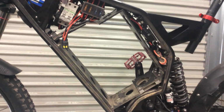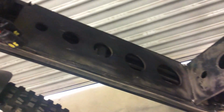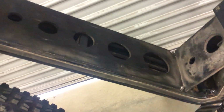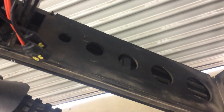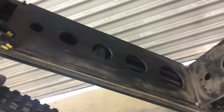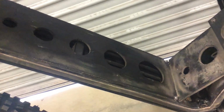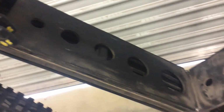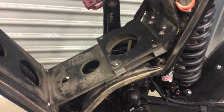I just installed the top part of the battery box. As you can see, I've drilled quite a number of holes through it, and it's actually galvanized sheet metal. And then I've painted it and put some, I think it was 3mm insertion rubber to give it a battery grip on it. But I punched holes all through it just to lighten it up. It also gets a bit of cooling in there as well, but mainly just to take the weight out of the sheet metal.